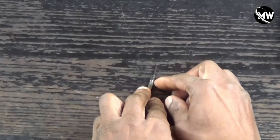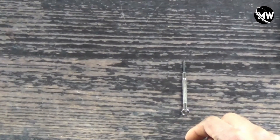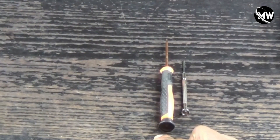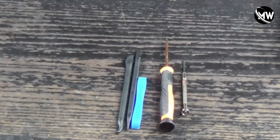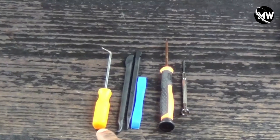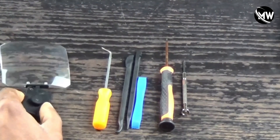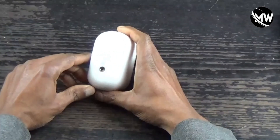Let's talk about the tools that are needed. You're going to need a pH zero-zero screwdriver or bit set. You're going to need a T5 or Torx five screwdriver or bit. You're going to need a spudger kit to use when opening the camera because the space is tight. You're going to need a small pick kit. Optional but useful is a magnifying glass.